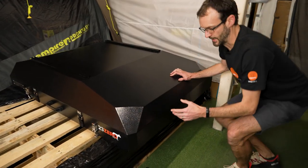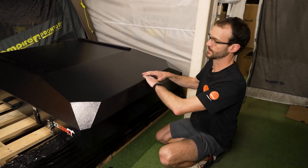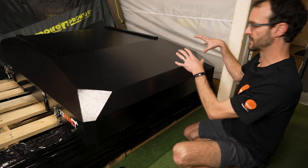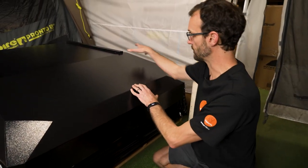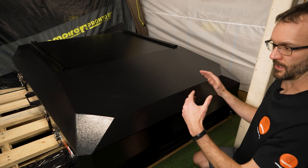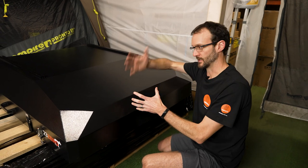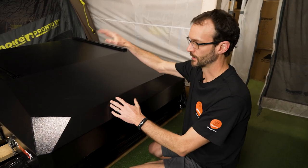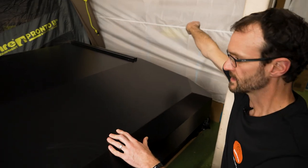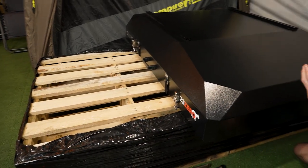The Panther has a slightly smaller footprint, suitable to fit on a dual cab tray or a smaller roof rack, and it folds out to make the most of the full length of the tent. The extra height allows space inside for bedding — I've got a double sleeping bag rolled inside here. It's important to note you can only mount this one way: standing at the front of the vehicle, the lid folds up towards the passenger side and the bed folds over the driver's side. You can't change that orientation.